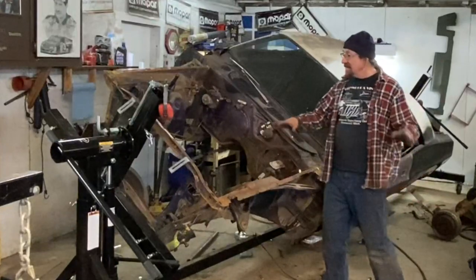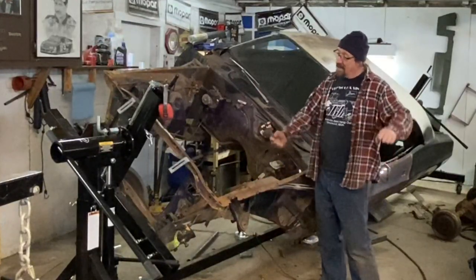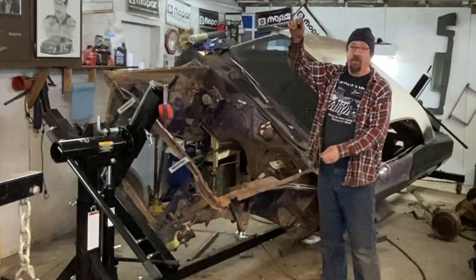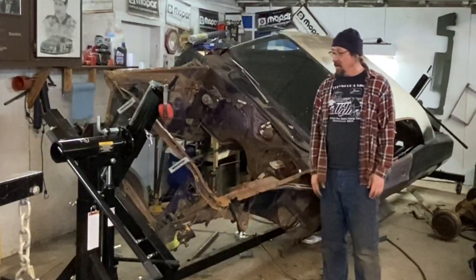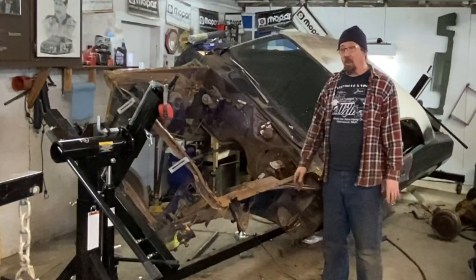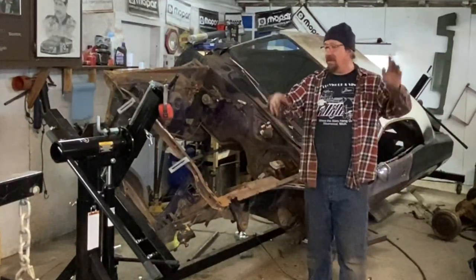That's about it. And the next thing that needs to happen on the rotisserie itself is it needs to get centered. It's bottom heavy right now, so to get it to turn, it's using quite a bit. And if it's exactly centered, it should rotate very easily without a lot of effort. So I went ahead and just tipped it up just to see what it was doing. And, you know, I'm kind of glad that it wants to come back to center. So a little bit's fine, but it's a little excessive right now. But until I get the doors off and get the glass out, things are just going to be wonky.